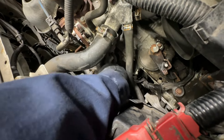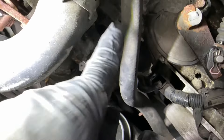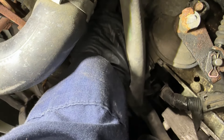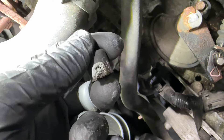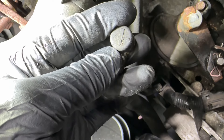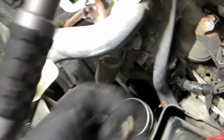The actual issue of why this is happening is the vent right over here is clogged. So we're going to take that out, clean it, and simply put it back in place. It is hard to get in there just because of the way the hoses are positioned, but the vent plug is right over here. This is it, and as we can see it is clogged and causing our issue. It's supposed to vent out pressure through here. Once clogged, it no longer vents and pops out the next easiest thing, which is that fill plug. You also want to install it pointing towards the driver's side headlight, or better yet aimed toward the bottom inlet for the intake.